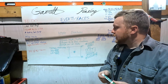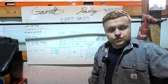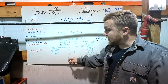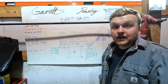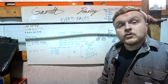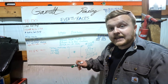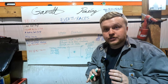One other good point — let's say you've got a car, especially like a really stock type car in some of these more stock classes — they're not actually a tube chassis that you can remove a whole lot of weight from. Let's say you're already close to your minimum weight. You still may want to increase your left side weight. So what you'll end up having to do is — let's say I'm already at 2,650 but I'm not at the percentages that I want — I still have to add weight and I'll actually be over my minimum weight. So I might be 2,700 or 2,750 pounds — I might be a hundred pounds over. I don't want to be, but if that's where I want my percentages, I have to add that in there. It all comes down to actual physical locations of your lead ballast and where you put them — that is the only thing that affects your weight distribution.